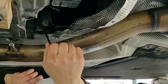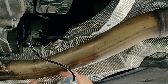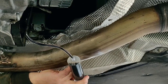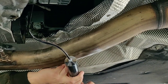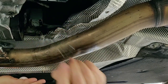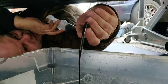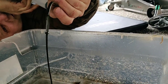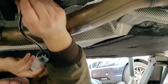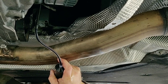I don't know if you can see that, but we got this wheel on the ground, that wheel is off the ground — we got the angle we're looking for. So remember this tool — you can't see where I'm sticking it in the hole, but I'm sticking it in the hole, and then I'm angling it down just like they do at the dentist's office. And look at this — I'm getting fluid! Look at how nasty that lifetime fluid is. Not that it being dark is completely indicative of fluid failure, but this vehicle has 90,000 miles on it, and I think BMW is full of it. I think the change interval should be around 50,000 miles. Of course, they don't want to pay for it, so they just change the specs and leave it up to the consumer to determine if they're going to take good care of their vehicle.